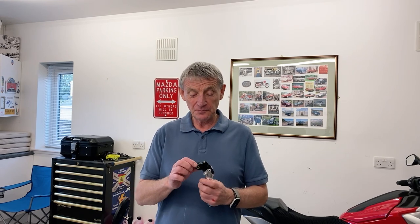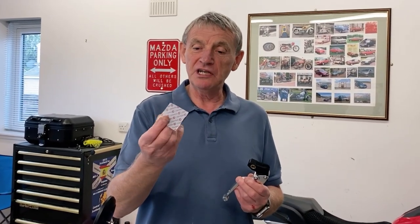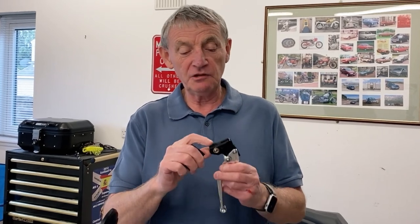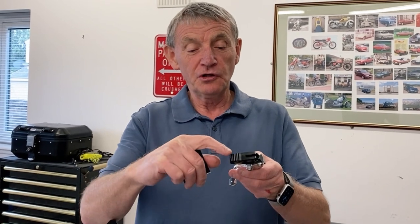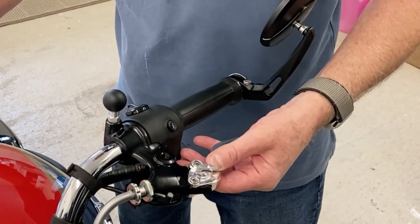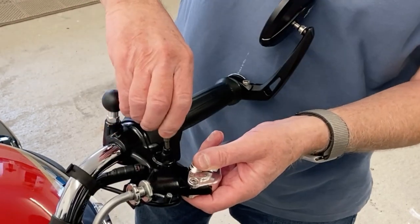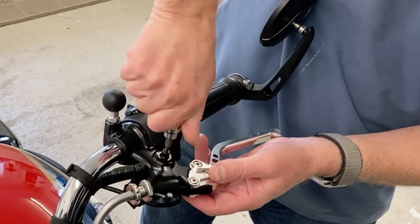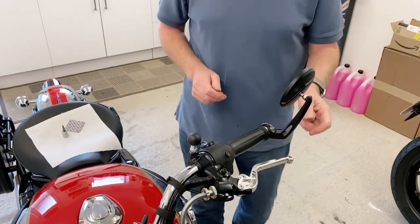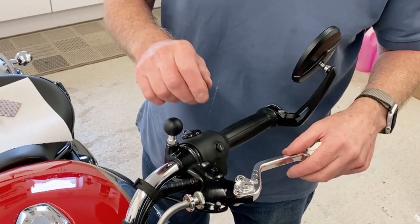I fixed the problem. All I had to do was put a wee pad on the lever. I had some adhesive velcro pads lying around, so I cut a tiny wee square off and fitted it onto the part of the lever which actuates the switch. With the clutch cable disconnected just to test it, I slipped the lever back in and temporarily put the screw back in. Even when you move the lever, now on position one, you can hear the clutch switch switching.